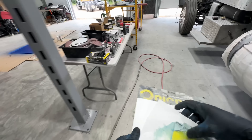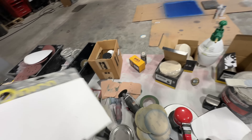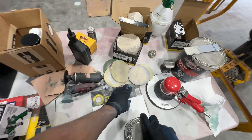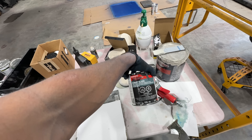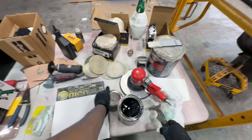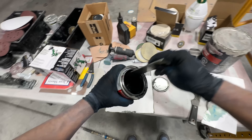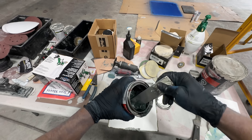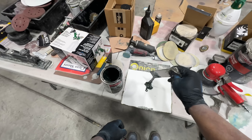So there was a tiny hole I actually found that I didn't even know was up there on top of the roof. Perfect time to fill that. Even when you clean up your workbenches, any flat surface just turns into a workbench and you end up using up all the space. I'll use a little bit of Bondo glass — this is a short strand reinforced fiberglass filler, basically Bondo with a little bit of fiberglass in there. I think this will go nice on the top of the roof cap since it's a fiberglass roof cap. The more you add, the more you have to sand off — so just a little to fill that small hole.